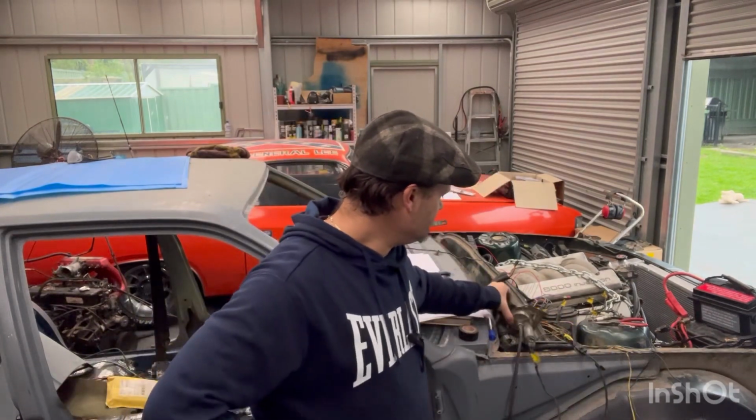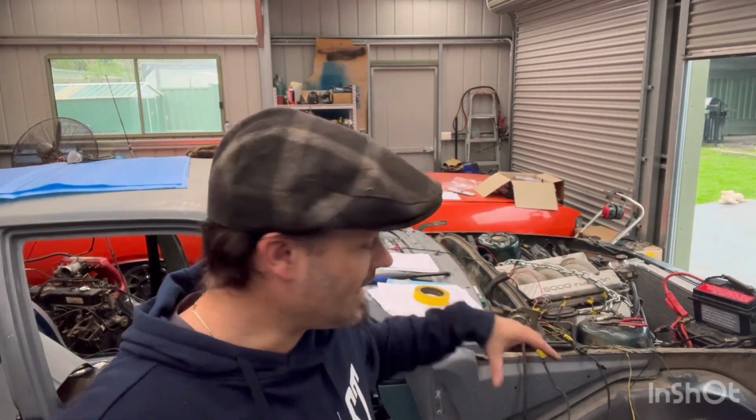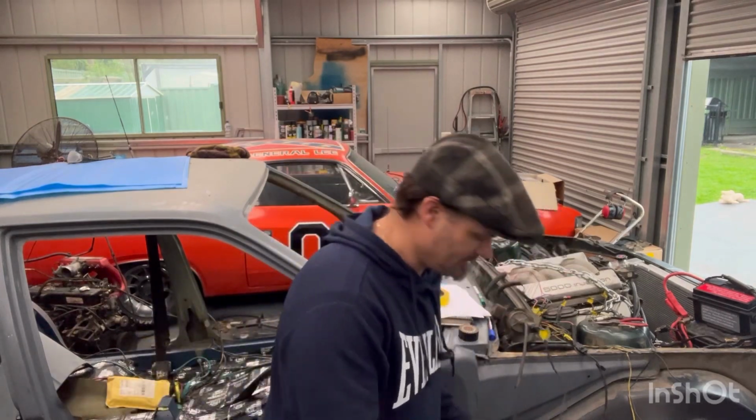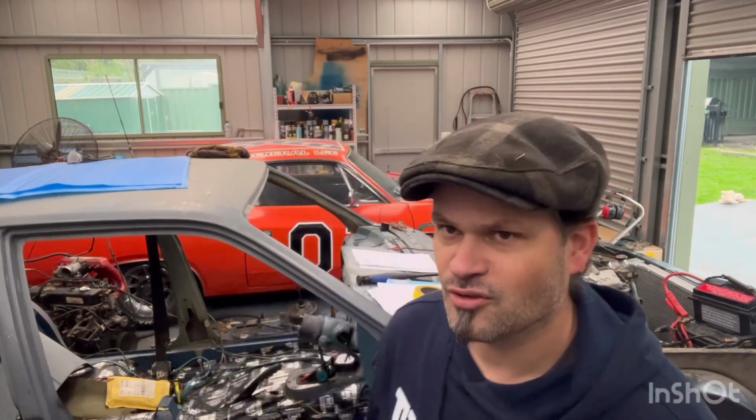Just playing around with this contraption, I plugged that in with the original harness plugged in, and turned the speedo drive, and what do you know? The speedo works. I was turning it at between 20 and 30 kilometers an hour and it added 400 meters to the odometer, but hopefully that part of the kit in there can sort that out.